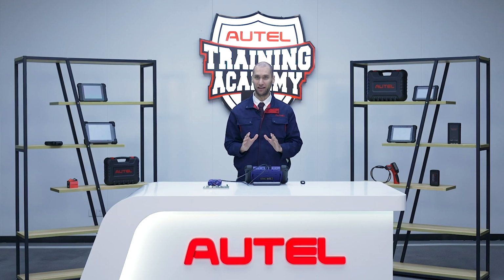EEPROM is hard to navigate. There are two scenarios for using EEPROM. One is if you want to add a new key using certain vehicles like BMW, Audi, and Porsche. Another is if you replace an ECU like the engine and need to read the old unit's information.